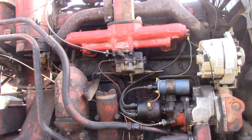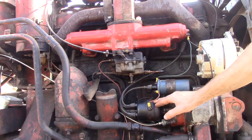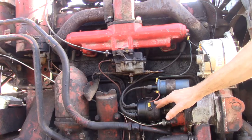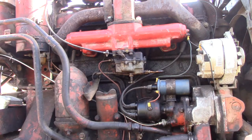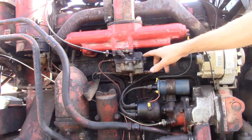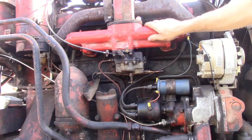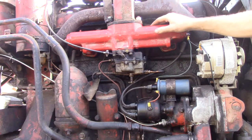There's quite a bit to go over here so we'll start with the sparking system first. You've got your distributor here, which is different than a gas model. This distributor is a counter-clockwise rotation, not a clockwise rotation. Your spark plugs for the most part will not be reachable unless you pull your manifold off, which isn't too big of a job — it just takes a little bit of time.